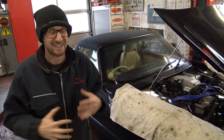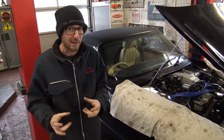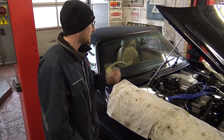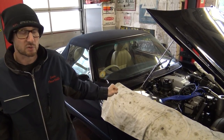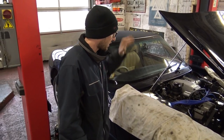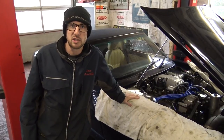It wasn't noisy or anything, but we know TVRs wear camshafts early - and that's still a mileage wear that can occur in any Rover V8 engine if not well maintained. So we took the camshaft out and it was definitely showing concave tappets, which we've got pictures of. This has now got the 285 camshaft in. We'll do some videos of that running up, maybe next week, which might actually be published next year now.